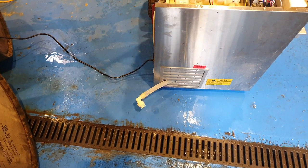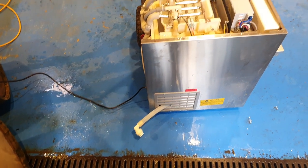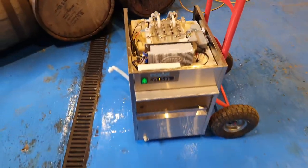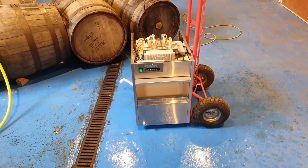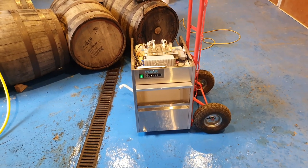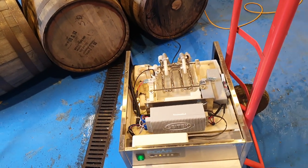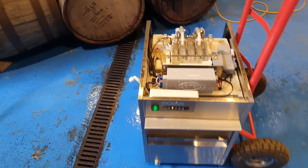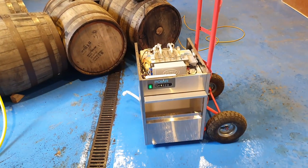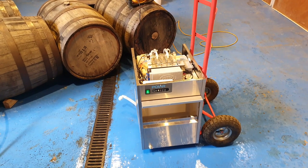It came out the back and then had to do a hairpin bend on the side — awful design. So I've just shortened it, cut a hole in the side, and stuck it out the side with a flexible pipe direct to a John Guest fitting, which should be easy enough to hook up to the drainage pipe. I really don't know why the engineers that design things like this don't think about how practical it's going to be to clean. It's in a food environment — it needs to be clean, make it easy to clean. We open in 10 minutes so I'm going to have to move quick sharp, but we've got some bagged ice to fall back on and the ice machine has finished.